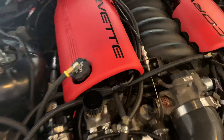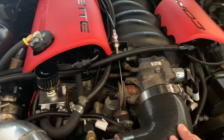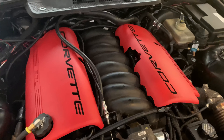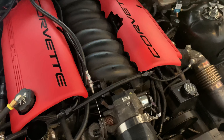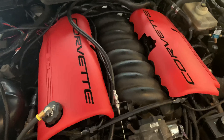The rest of the top end: I have LS9 head gaskets, LS7 lifters, and LS7 push rods to have everything match up nicely. My fuel lines initially were eBay -8AN fuel lines all the way through. They were not PTFE and I think I had some fuel problems, so I swapped them out to Vibrant Performance PTFE fuel lines running all the way from the pump to the regulator and back. I originally had a Walbro 450 fuel pump but was having some issues — it was too low in the tank and wasn't sucking up right — so I changed it out and now I have a Walbro 525. So far I haven't had any issues on the stock wiring, though I'll probably have to upgrade the fuel wiring at some point once there's more demand out of that fuel pump.